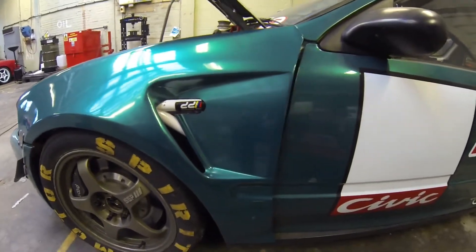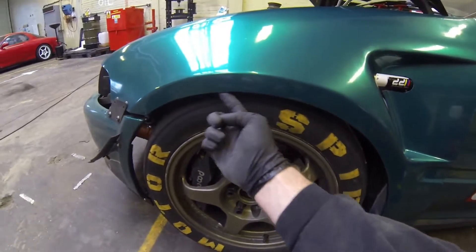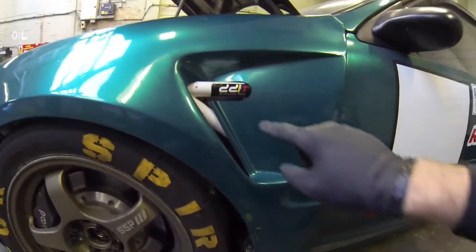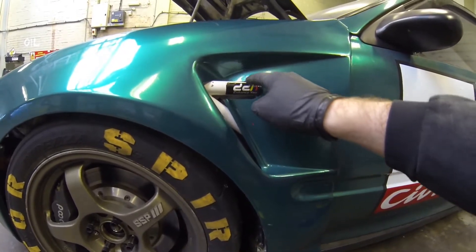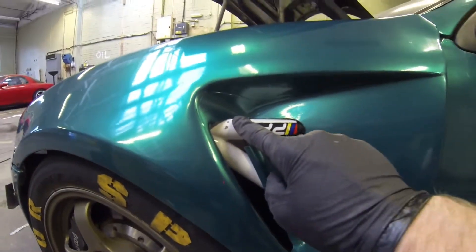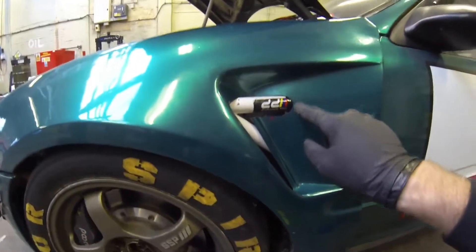That's as far as I think I need to go. It's pushing the wing up slightly but it also supports the wing, makes it really solid, and pushes it out higher up which gives me more clearance under the tire — so that's a good compromise. Unfortunately I cut the hole a little low because the wing moves down the closer you get it to the car, so it's really difficult to judge where to put the line. I kept cutting the bottom line and creeping the top line further and further up to get it over the bar. I may take out a little bit more to bring it down a touch, but it feels so much more solid than the other side.